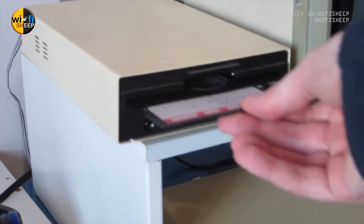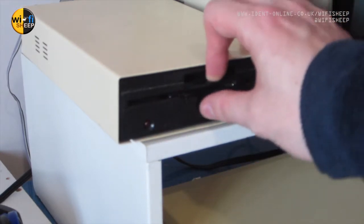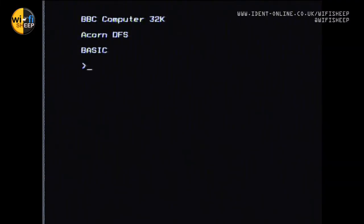For today's demonstration we'll be running on an original BBC Micro Model B, which is a 32k of RAM machine, and we'll be running off a reused five and a quarter inch floppy disk. We're using a color composite output from the BBC Micro — this is modified, going via the RF modulator which has just had its tuner cut and the composite feed fed straight through — so the quality probably won't be as good as on an emulator, but I wanted to show how this game actually works on authentic hardware. We'll put the disk in the drive and do a Shift+Break to load up.